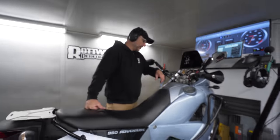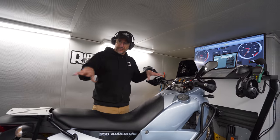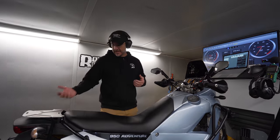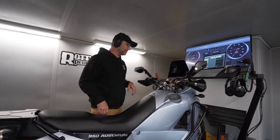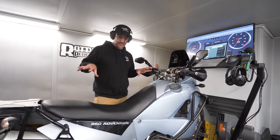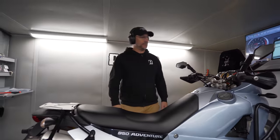Okay, so we're going to do a dyno pull in fourth gear. We put 40 pounds in the tyres and try to keep everything as consistent as we can before and after. We don't want to do pulls with the tyre at 20 pounds one day and 40 pounds another day — you're going to get inconsistent results most likely. So we're going to get the most consistency out of it and we're going to do an initial baseline pull and see what this thing puts out, then do the modifications and come back.